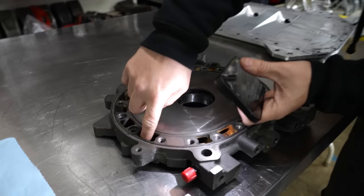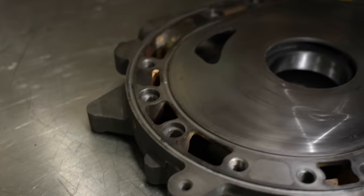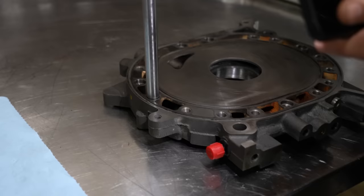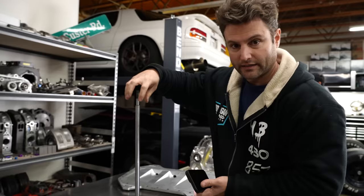That is all the material we have to work with. You can actually see the entire outer casing of the casting. We are going to try and helicoil these. This is what's really nice, is that, again, the threads are recovered, and if you get it just right, it threads and it holds. But see the wobble on those threads? They're pretty damaged. So I wouldn't feel comfortable putting 30, 35 pounds of torque on this.